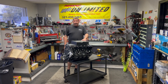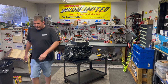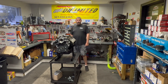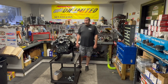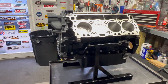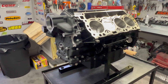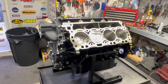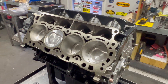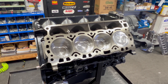I'm going to bring this thing in the back, get an engine stand on there, flip it over, and then we'll start putting in some lifters and cylinder heads. I'm back — I got the motor all flipped over and I'm getting ready to clean the deck surfaces. We'll get the lifters installed, head gaskets on, and install the cylinder heads. As you can see now with the motor flipped over on the engine stand, you can see how shallow that F100 oil pan from Holley is. We've got the pistons in here with a slight inverted dome. The lifter bores are all cleaned up, the rear main seal's on, and we're getting ready to clean the decks up, install some lifters, and take you along.